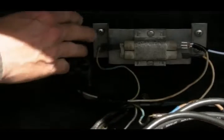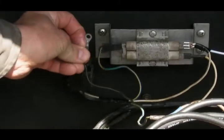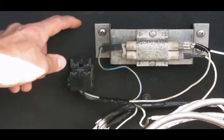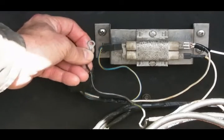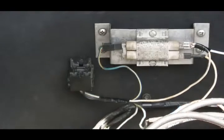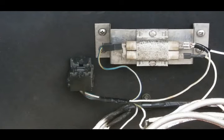The fourth wire is a ground. There's ordinarily bracketry that runs across the back of the engine compartment, and one of those machine screws has a bunch of ground wires attached to it — not just this one, there's a whole bunch. One of them is for the engine compartment light switch and a couple of others. They're all bundled together on that machine screw, and then one wire goes from that bundle down to either the intake manifold or the valve cover — that's how it's connected to the engine block ground, which is connected to chassis ground.